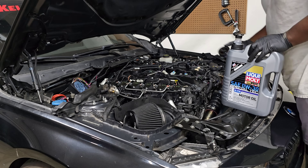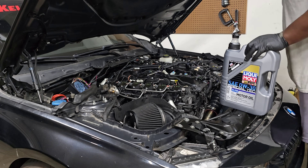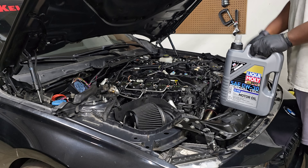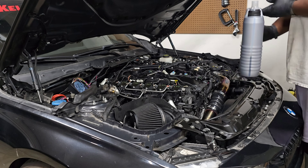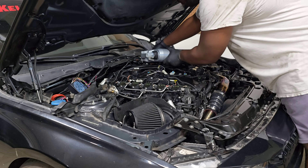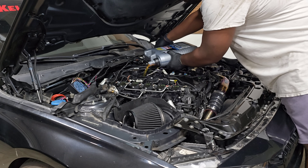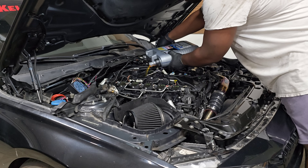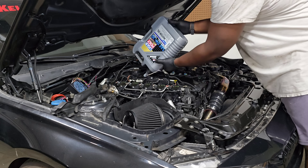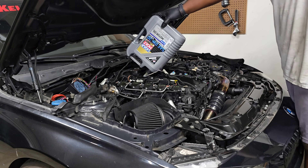It's finally time to re-add your fluids — please don't forget to do this. This is probably my biggest fear: doing all of this work and then realizing you forgot to add oil. If you don't add oil, you'll ruin your new engine very quickly and all that money goes down the drain. What I like to do is put my jug of oil on the driver's seat so if I were to forget and try to get in to start the car, I'd see it right there and remember. Go ahead and add in your 6.5 liters of your preferred oil — I prefer 0W30, so that's what I'm using.